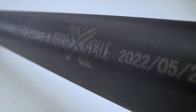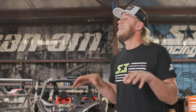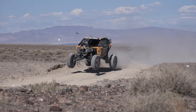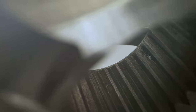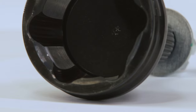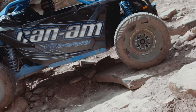The most notable thing about these Titan X axles is how big they are. I don't have baby hands over here, but when I grab a hold of this thing it sure does look like it. We went 35% bigger on the axle bar than most OE axles, and on the CVs we stepped it up 20% above most OEM axles. We tried to fill up all the room we had at the knuckle and near the differential, because everybody knows bigger is stronger.